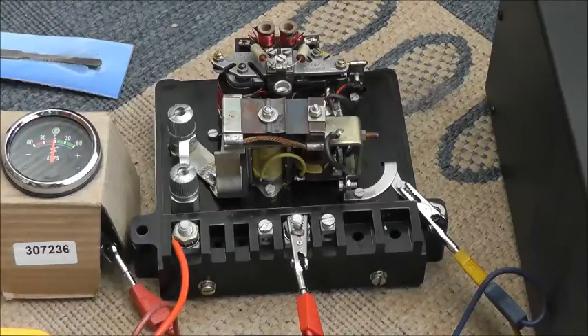So what I've done here is taken the lid off the box and cleaned up the contacts. There's a pair of contacts in here and then another pair of contacts over on this side. I cleaned them up with some abrasive paper and also with a little bit of metal cleaner to dissolve any residues of oxide or carbonate or whatever it is that forms on these contact surfaces. Now I've set the box up to try to test the functionality before I put it back on the shelf as a working spare.